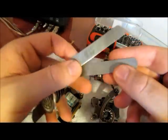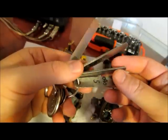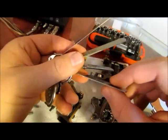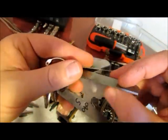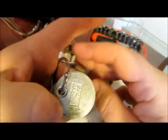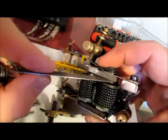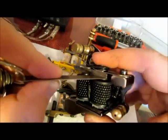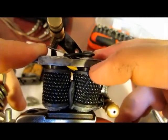I have this feeler gauge stock set up with references: here's your dime thickness, here's your nickel, here's your color packer gap. I also keep a thin one here for checking the gap on my rear coil. When everything's set up, you should be touching the front coil with your armature bar and have a real thin gap in the back.